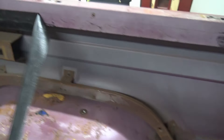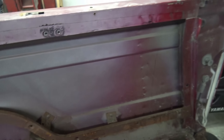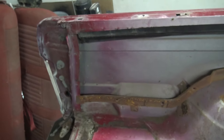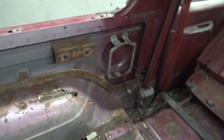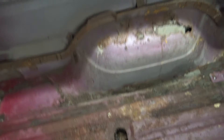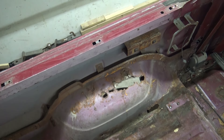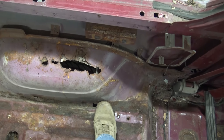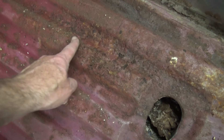I haven't dug too far into the fender itself, but overall the top of the fender right now is looking pretty clean - rust free. That's good. Same thing on the other side - it's looking pretty clean and rust free. What is not looking rust free is the driver side. The driver side has got some heavy rust at the wheel well - the inner wheel well fender is gone. Down here on the floor where the fender meets, it's gone. The floor itself has some pretty heavy rust. We'll get underneath and see how far through it goes.